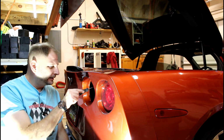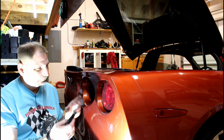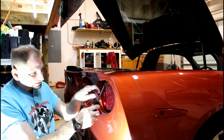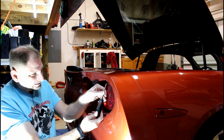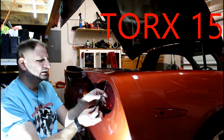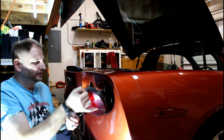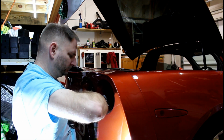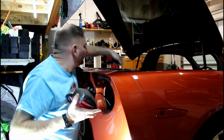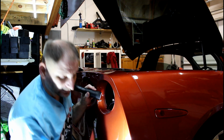So now I'm going to go try in the back of the car and find the reverse wire. I thought I'd be able to see all these harnesses. I can and I can't. So I took out the inner tail light. I'm going to take out the outer tail light, and hopefully that gets me where I want to be. But this will show you what you missed already. Remove one fastener, pull the little lip down, and this connector just slides right off. I found the harness. I found the plug that goes all the way down here. Two places it goes: that side light, this reverse light.